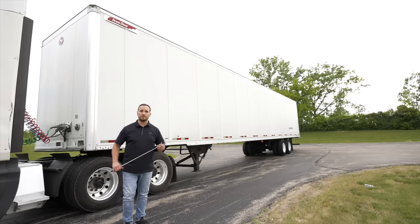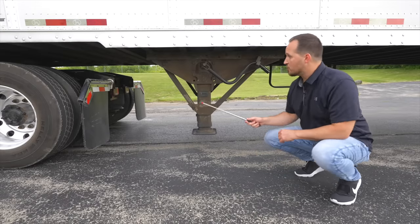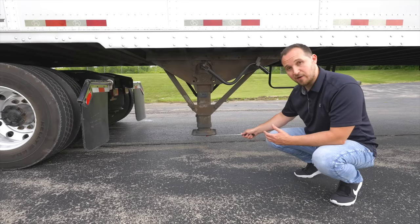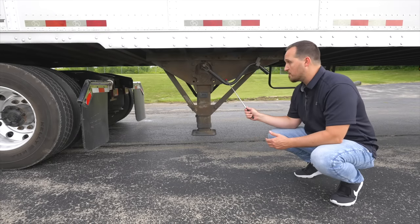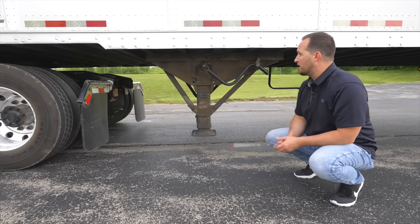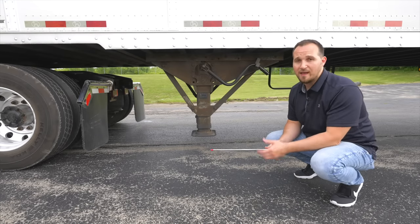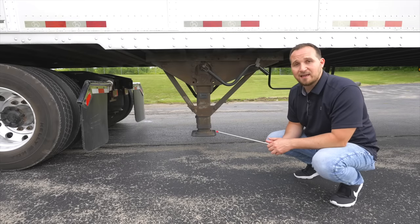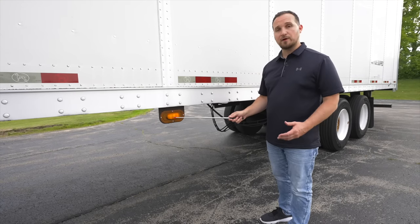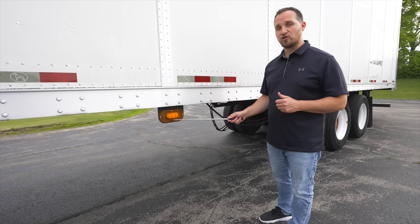After that, we're going to move down to our landing gear. Make sure your landing gear devices are not broken, not cracked, on secure. The bottom base and legs are not broken, not cracked, on secure. You would check your arm to make sure it brings your landing gear up and down and that the landing gear arm is secured properly on the landing gear device hook. Now we're going to move down to check our side marker light. The side marker light is not broken, not cracked, on secure, proper color. It functions as a running light, turn signal light, and four-way emergency flasher indicator.